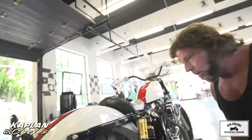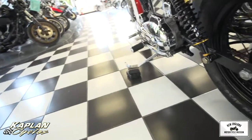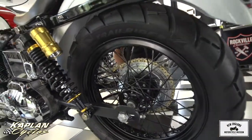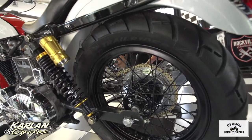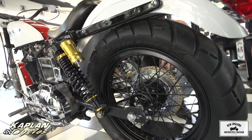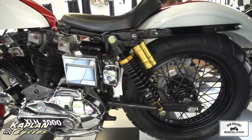The brake system on the front is brand new. The brake system on the rear is brand new. This is the actual brake housing — it's a brake drum. This is a brand new NOS brake drum that we purchased, which included a brand new sprocket. It has a brand new brake pad, so the whole brake system on the rear is brand new. It has a brand new gold chain — top of the line, very expensive. The rear wheel bearings were removed and pressed out, with brand new ones pressed in. Brand new Avon EV54 matching rear tire. Look at the tread pattern on this thing — it's almost like a dual sport set.